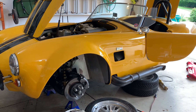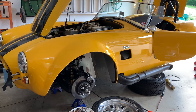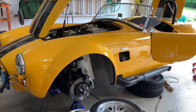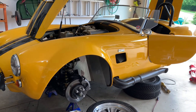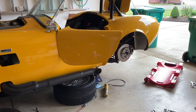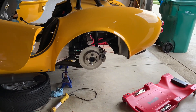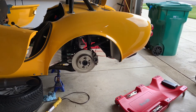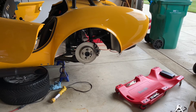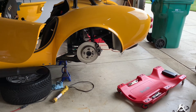Next day — I don't have a lot of time but I have three things on my list. First, inspect all the brakes again since I replaced those washers yesterday. Second, for the battery — I did some research online and this seems to be a common issue: if you put the girdle-style rear-end cover on, there's not enough clearance for the battery tray. There could be options like a drop tray or moving it to the side, but I don't want to tear out the sheet metal and redo it.